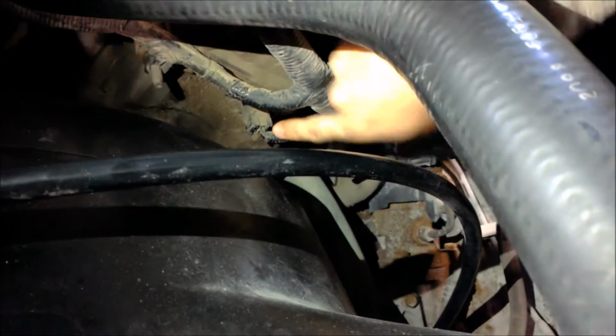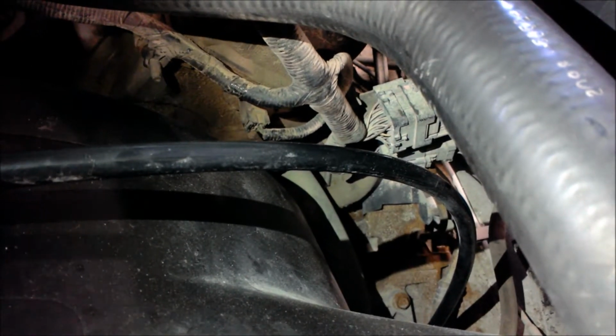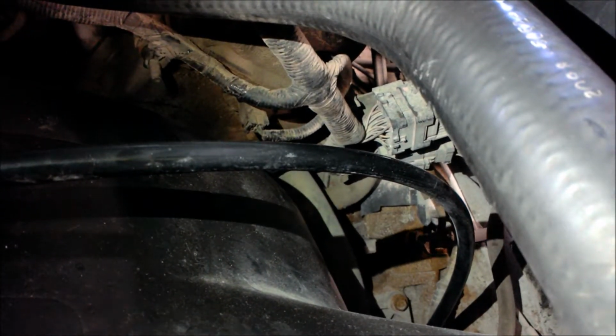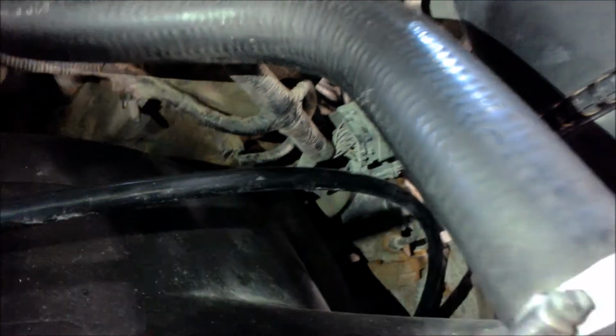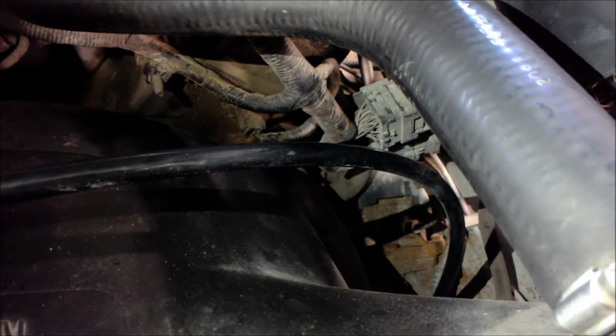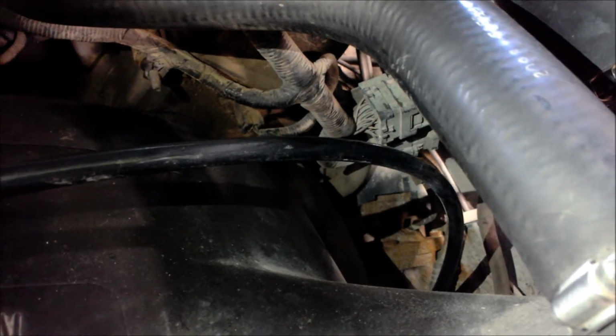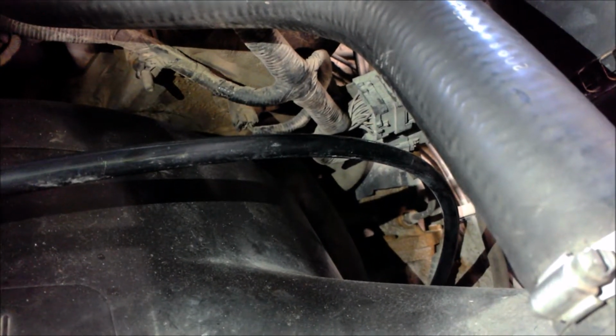This will be right there, and there will be a 2-wire sensor attaching right over there. As you can see, that will let you know what the position of the crank is at a given time, because when the vehicle turns off, it's not going to stop at top dead center each time, and timing's not always going to be perfect. So that allows the ECM to know where the valves are at, if they're open or closed, or overlapping, and allows proper firing order in our engine.